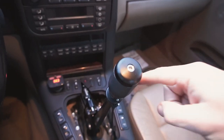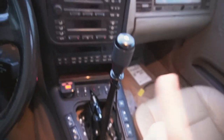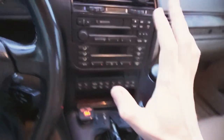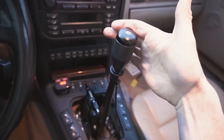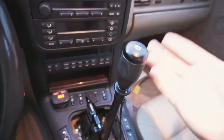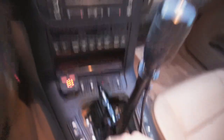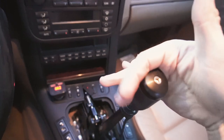This is a little bit weird — it takes maybe 10 minutes to get used to. The cool part that's really fun for daily driving is that when you go from second to third, which is one of the most common shifts in daily driving, all you have to do is push it straight forward. It chonks its way through neutral, centers itself automatically, and goes straight into third. So your second-to-third shift is almost like a reverse sequential — you don't need to pull the shift lever over. It's just a straight shot, very fast and efficient. Fourth and fifth gear are roughly the same as normal. To go to fourth, you pull it back through neutral all the way to fourth. Then fifth, you go up and over. And if you want to downshift from fifth to fourth, this centering spring helps you immediately get back into fourth — just pull it straight back. No vagueness, no searching around.